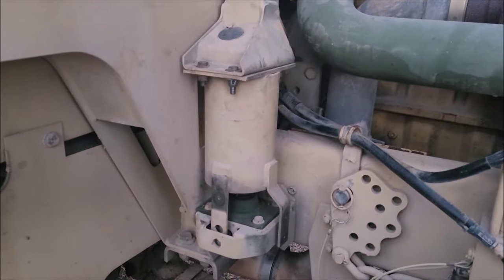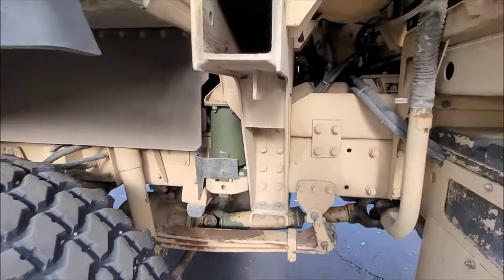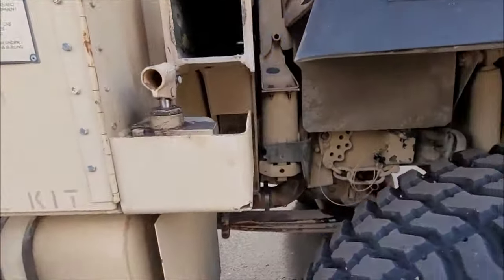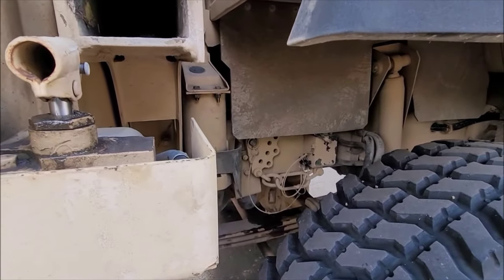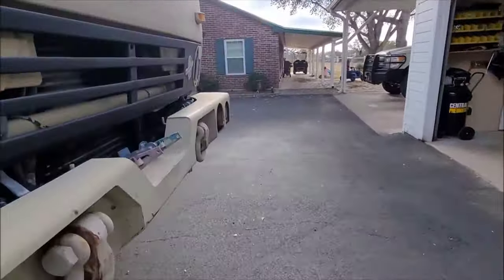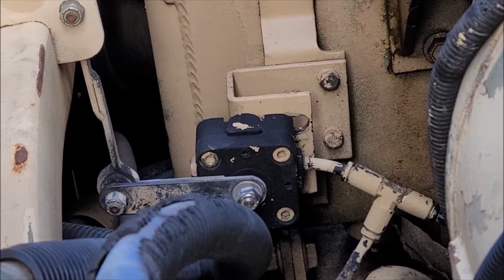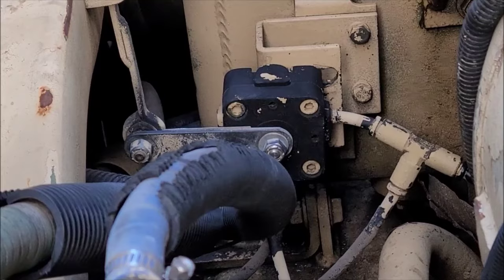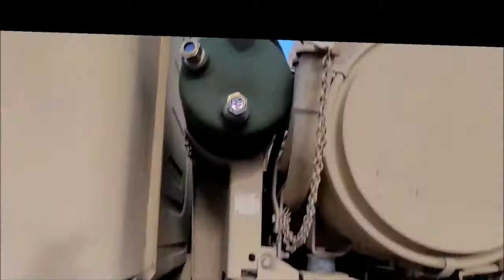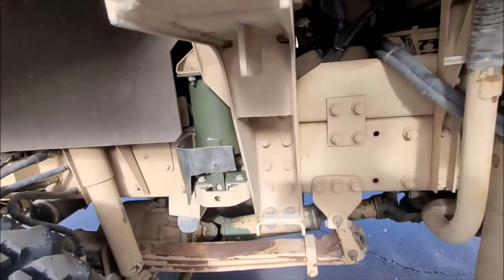Passenger side is all installed. Hopefully it will go relatively as smooth on the other side. I finished up doing the driver's side yesterday evening — phone battery died and it got too dark to record anything meaningful. I already tested it and everything's working. You can hear the air go to it and it lifts up — it's working. I had to adjust the cab tilt, which adjusts how high or low the cab sits. It was tilted all the way back on mine, which made the cab ride a little more stiff and made it look like the cab was tilting forward. I moved it right to the middle and I'm happy with where it's at. The bags are full, I can see how far above the pin it is, and there are no air leaks. Happy with it.